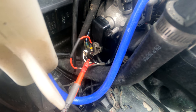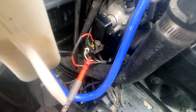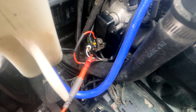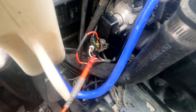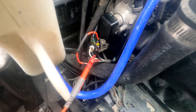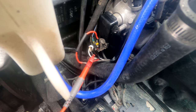Mine is spliced because I had to put a new throttle position sensor on it, so all the wires are a little bit longer because it's pretty tight in there. What you want to do is make a small splice in the white wire — just use some wire strippers and spread apart the plastic, trying not to cut through the copper wire. They're pretty thin so be careful.